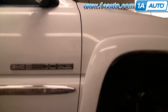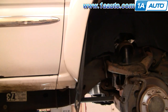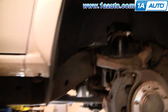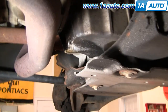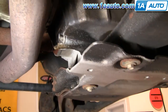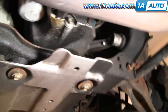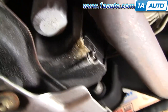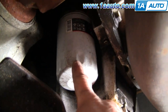I have the truck up on a lift and I have the tires off for a totally different purpose. The great thing about these trucks is that you can do an oil change with them just sitting on the ground because they're so high up. You want to go underneath, and here you can see your oil drain plug. Underneath, the two things you basically need are your drain plug — it's a 15-millimeter bolt — and your oil filter right there.